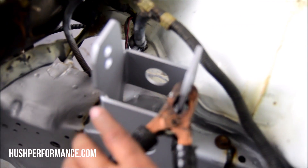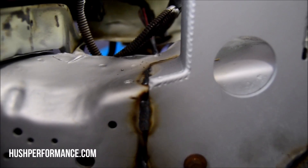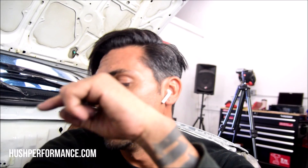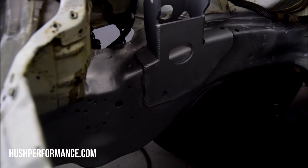You saw that was a much cleaner weld — you can tell when it starts welding really well because it doesn't make that popping sound; it's really smooth sounding and of course less dirty. It was a combination of things: wire speed, heat range, and gas. These were my settings on my Hobart. I think what I wasn't paying attention to is that the cooler is right above me and was blowing all my gas away — that's what happened in the back and underneath. At least the welds on top are super clean, almost no porosity. I went ahead and threw another coat of zinc right on top of the welds because I want our paint to stick well and the weld itself could have burned off some of the zinc.